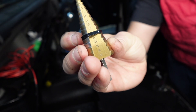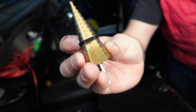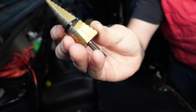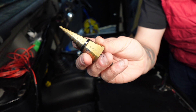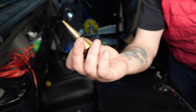What I've done here on the step drill is I've actually put a zip tie on the 22, which is the next step down from 20, which is what I need. That means I'll know how far to go in — it's a nice little trick. You can use a Sharpie pen, but the little zip tie is a bit better because you've got it on there just in case you miss it. You can then drill through to 20 mil and you know you've got the right size.